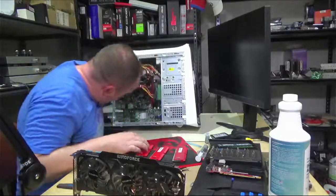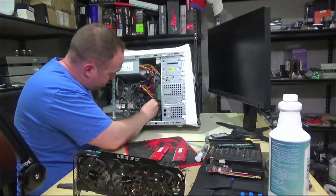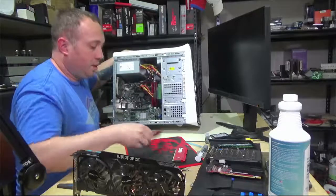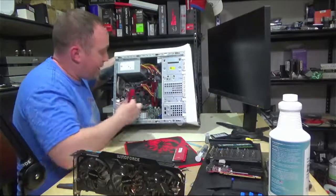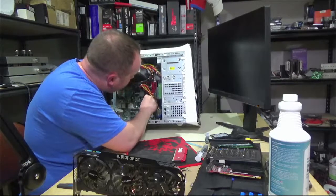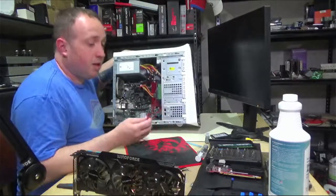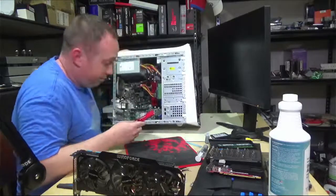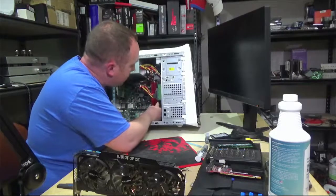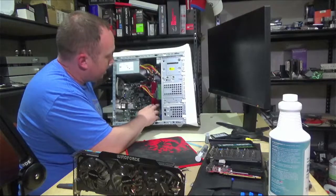Okay, so this is 4. It's going to go in the other black clip here. So not side by side, but in the same color of DIMM slot. I've had RAM kits that didn't want to boot, and then once I swapped them around and got them aligned by serial number in this configuration, they booted and worked fine, as intended. So we're going to keep that just like that: 2 and 4 in the black slots, 6 and 9 in the white slots.